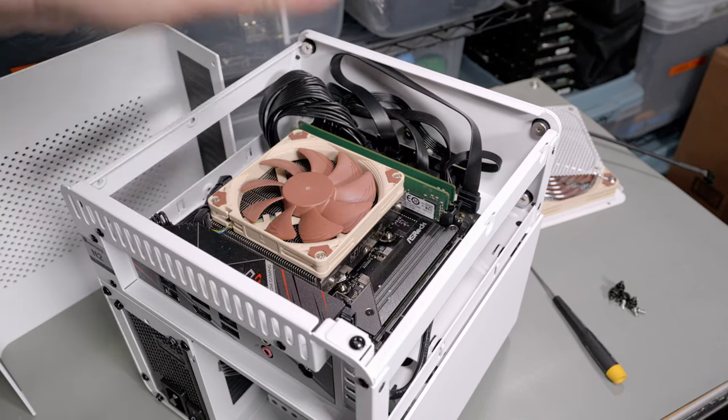I chose this board because it has two M.2 slots — one 3.0 and one 4.0, though since this processor only does 3.0 they're both effectively 3.0. The other board I have linked only has one M.2 but it's easier to find and cheaper. If you're not too concerned about a dual redundant drive it's not a big deal. I specifically got these because this is going to be a remote backup NAS — I may run VMs off it so I wanted a faster drive.